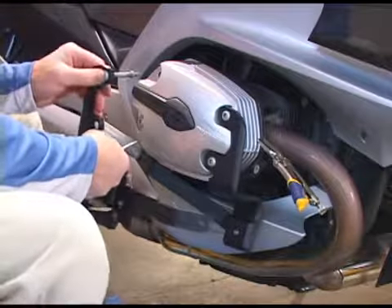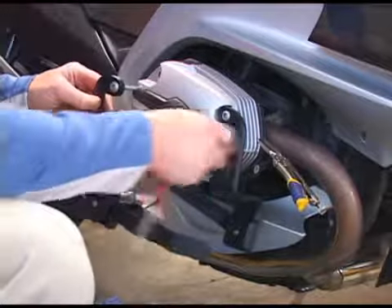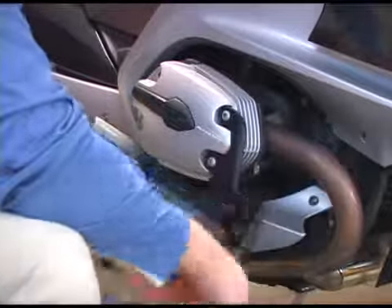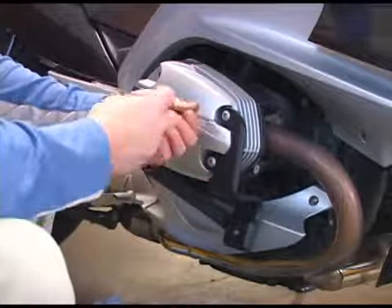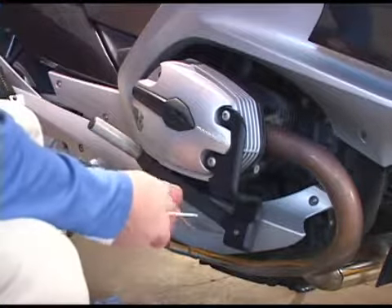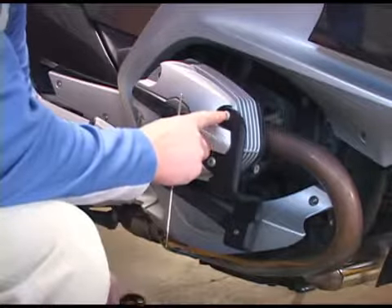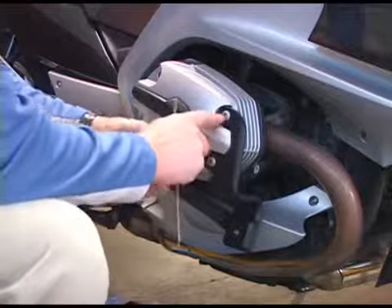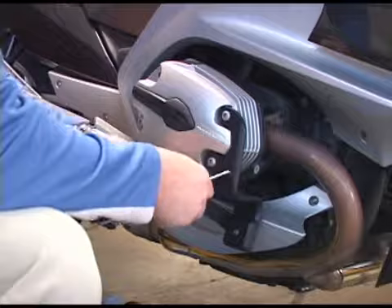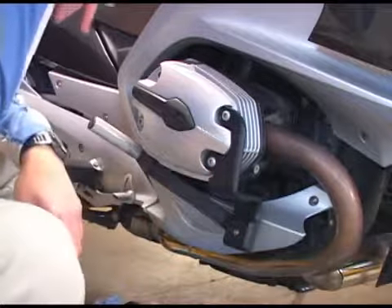Lining it up and tighten it. Then you can take off the vice grips when you get those mounted. Note that our bracket is a little bit thicker than the washer, so when you tighten the bolt, don't go to a full 5 foot-pounds — something less than that, maybe 3 or 4, just enough so you don't have oil leaking. And we'll talk about preloading the spring a little bit later.